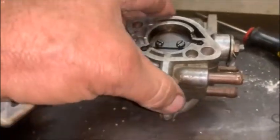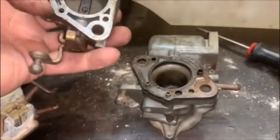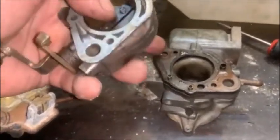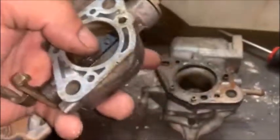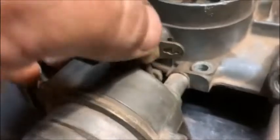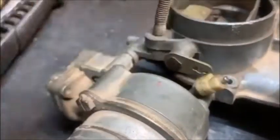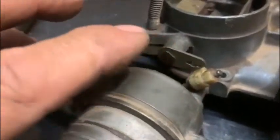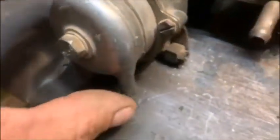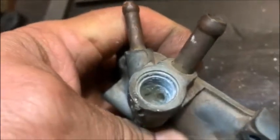On this model the base comes apart with two screws - there and there - and it just comes apart like that. I'll have to have new gaskets made for it; I've got a guy who designs them and laser cuts them for me. This little choke connection is broken unfortunately, but I've got something on another carb that can work there, so that's not a problem. And then I opened this up - look at all the gunk in there. It definitely has to go in the mild acid.